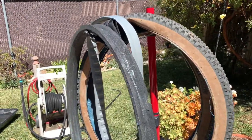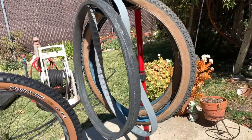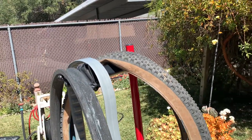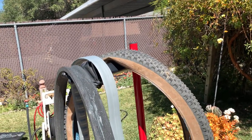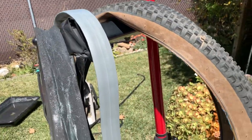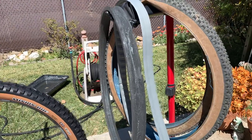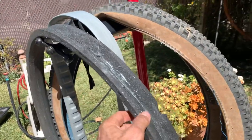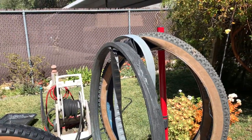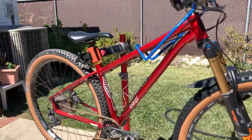So that's my long talk about tires and tire inserts — pick and choose what you want. The Rim Pacts are really inexpensive and work great, just be prepared to carry extra sealant because they will sponge it up. The Cush Cores are more expensive but won't suck up your sealant, and for aggressive riders the thicker density offers more protection. Note that Rim Pact also has a pro line with thicker density foam.